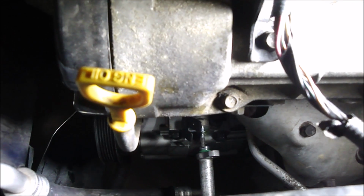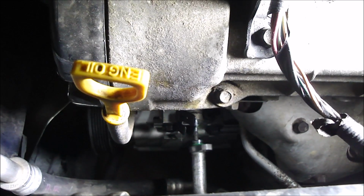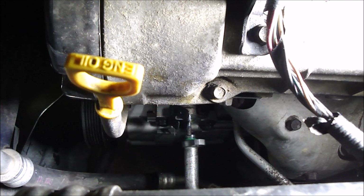Okay, got all the bolts on. I had to go up and down multiple times because as soon as I get the bottom side tight, then the top side will need to tighten more. I think it's because of the paint not allowing the compressor to be seated all the way on the little inserts that go into it. So let's put this on. It takes a 10mm nut. Alright, and don't forget to plug this back in.